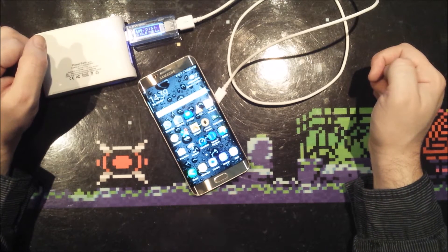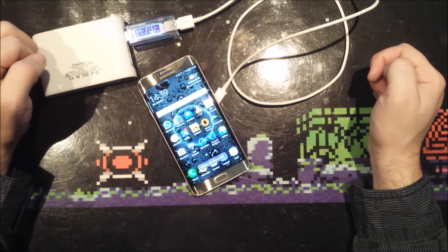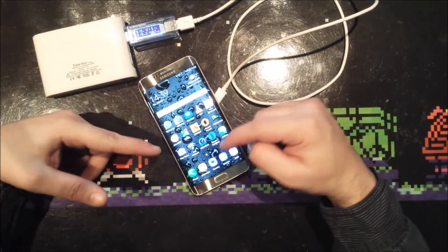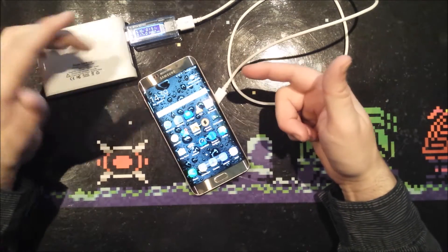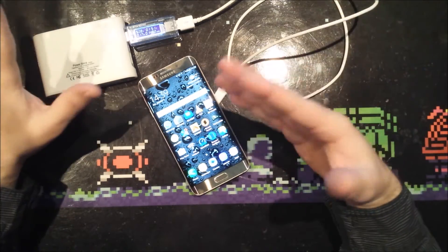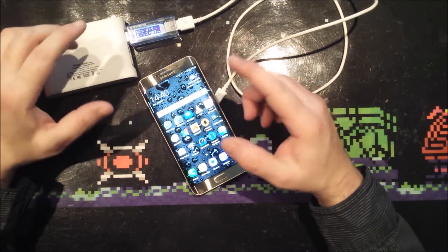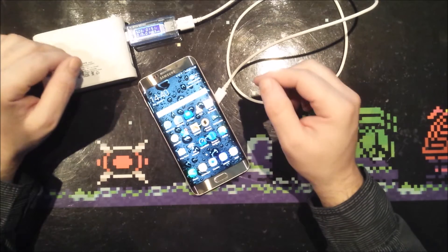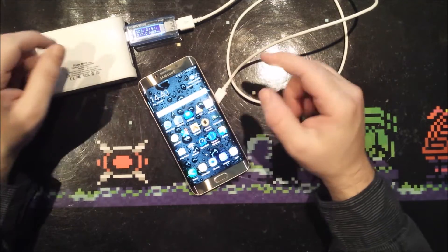It's drawing 200mA, now 170mA — and that's all it does. And there you see, it just restarts the charging. At least the phone thinks the charging is restarted. I don't know exactly why — maybe the pad thinks the amount of current amps is not enough, so it restarts. But it only does that when the phone is near full. Currently it's at 93%, and every time when the phone is empty at around 20%, it works until probably around 80–90%, and then it starts doing this.